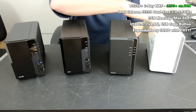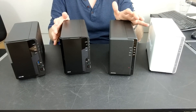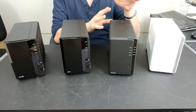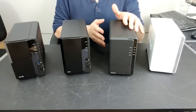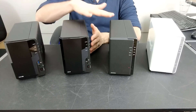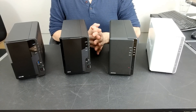It's genuinely the most popular of the 4, but that doesn't mean it's suitable for you. Let's talk about what these 4 devices have got in common. Obviously, they're all 2-bay devices. They all support their own RAID configurations, though it's worth mentioning that only three of them support Synology's own Hybrid RAID system, SHR. The Play may have only recently acquired that as part of an update. So if RAID requirements are important to you — particularly fluid RAID upgrades — and SHR is very popular for that, you should really only be looking at the DS218 and DS218+. But otherwise, they all support RAID 0 and RAID 1 level configurations.